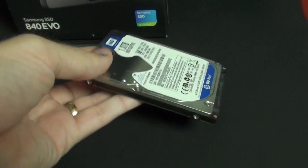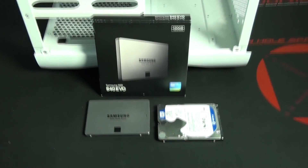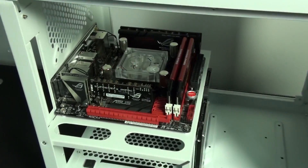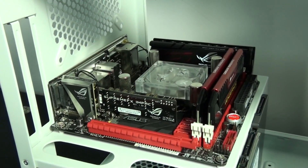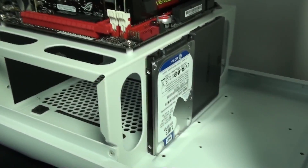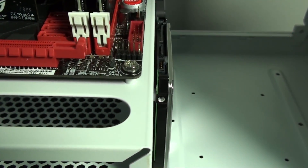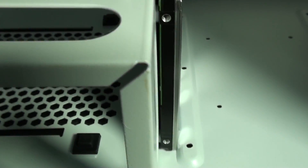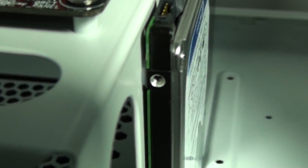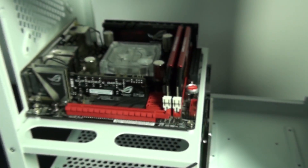You don't have to do this — there are ways around it, you can leave some bays in position, but it's just going to look cluttered. So 2.5-inch hard drives are the best option here, because the Prodigy has five 2.5-inch mounting positions even without all the bays. I've also put a couple of plastic washers between the hard drive and the case to give it a little breathing space and to prevent any possible shorts.